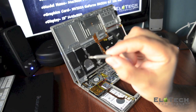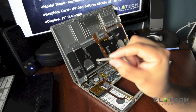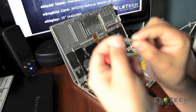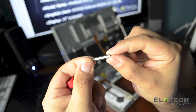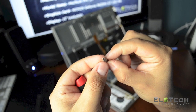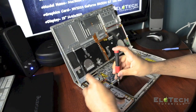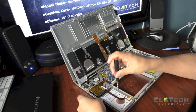I'm going to replace it using a T6 torx screwdriver — it's hard to focus but I'm going to open it. It's a T6. This is what I'm going to use to remove the two screws that are holding the hard drive.